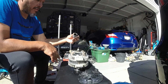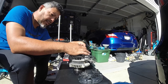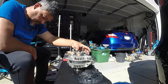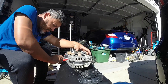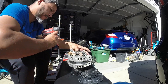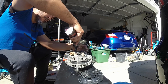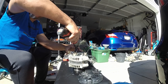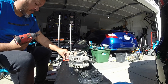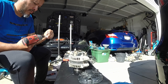As mentioned, you need to line that up with the allen wrench to hold the brushes back in. Push it down, take the tool out, and put the bolt smoothly back in. Now if you do have an impact driver and don't have experience with it, I suggest you do it by hand. I've been doing this so long that I know how much torque these things can take.